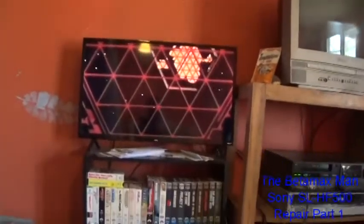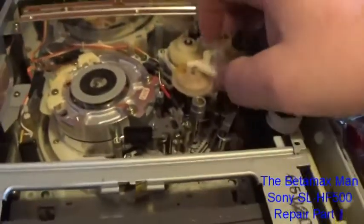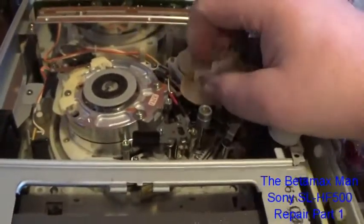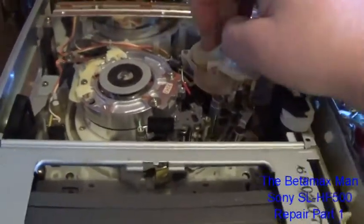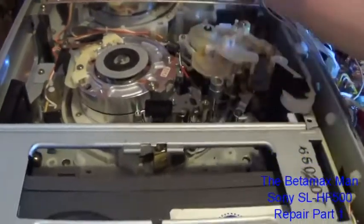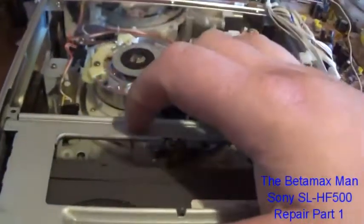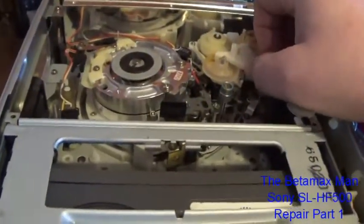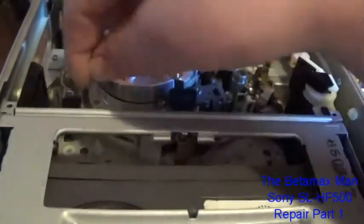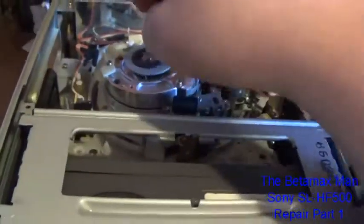The servo is now locked into place. There's something going on with the pendulum gear here — this is a clutch mechanism. The motor powers one side to do one thing and then switches over to the other side. The motor spins this side to bring the tape into the machine, and then a switch activates telling the motor to switch over to the gear that threads the tape around the head drum. Then the solenoid engages and it will play.